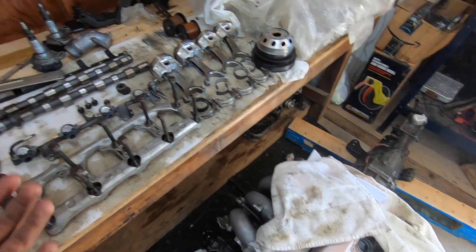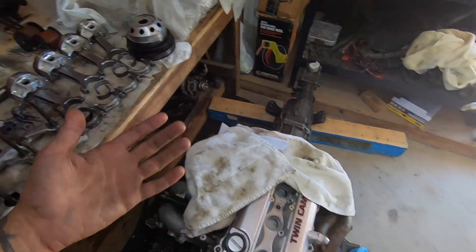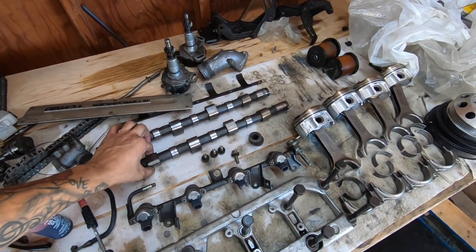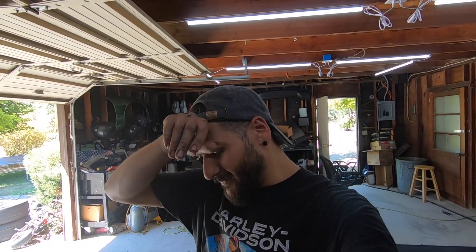When we were about to put the trans on and drop it in, I realized — are you supposed to do that? I checked the exhaust cam from the old engine and it's just super scored up. We pretty much decided it's not worth risking ruining my new Tomei cams that are in there and sending metal through the whole engine.